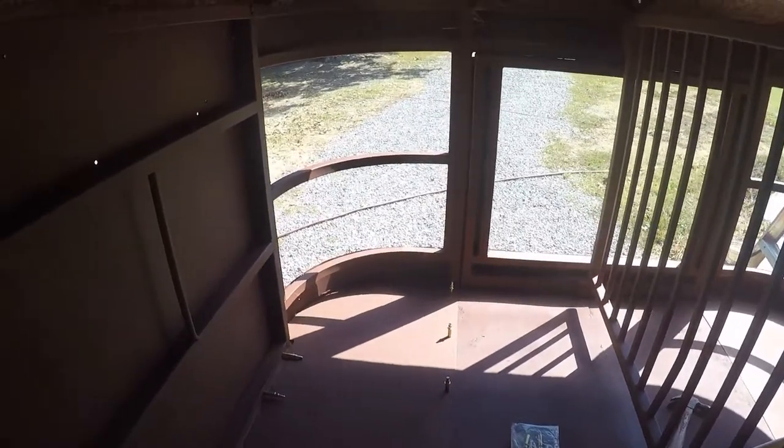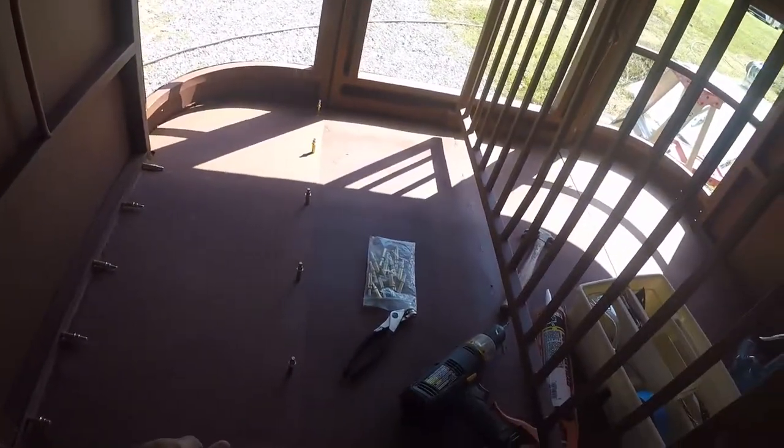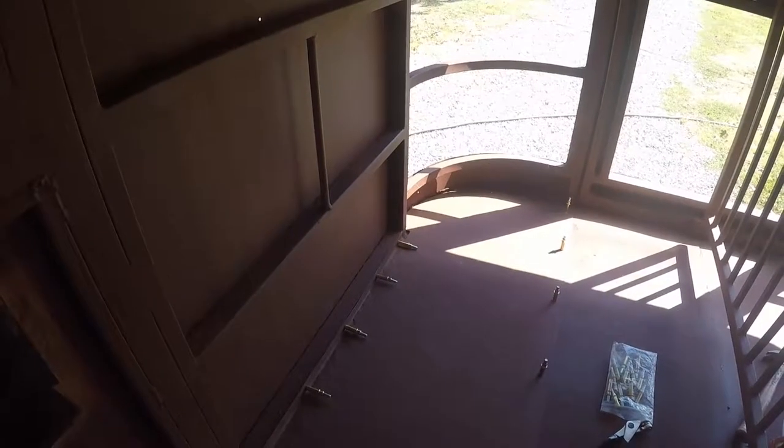What I'll be doing now is I'll pull this part out, clean up the drill holes, vacuum up some of the shavings, and then I'll put some sealer down, put the part back down on the sealer, and shoot in my pop rivets. One thing I thought I would mention is make sure you get a lot of drill bits, because drilling into the steel you tend to break a lot of bits.